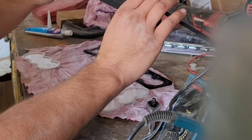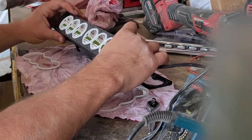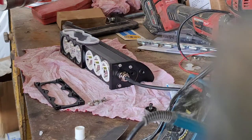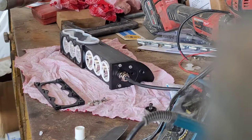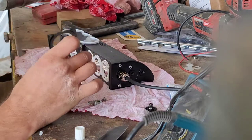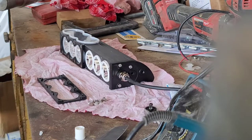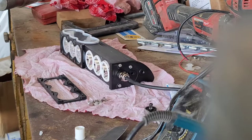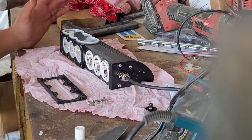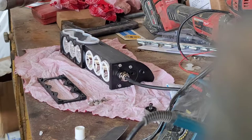I'm going to get everything cleaned up, crack open the silicone, and get everything sealed. I got the first side sealed back up and wanted to do a proof of concept first. Because we have two sets of gaskets, we're going to have to do two separate layers of silicone. You don't have to do this, but spending an hour getting your light bars sealed up properly before you install them is just going to help eliminate headaches down the road. The more effort and time you put into a project like this now, the fewer issues you'll have later.